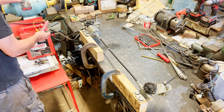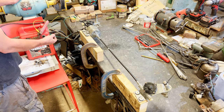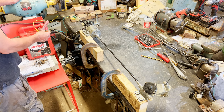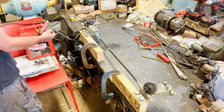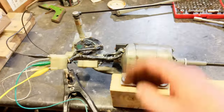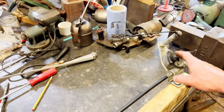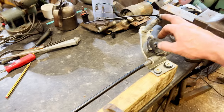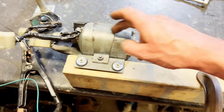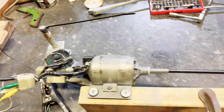There you are — it's working nicely. Feels alright. And then if you take the live away, it will park. So it's the parking switch that allows them to go back to rest. And obviously this has to be timed to that one, but we can double check that on the car. That's part of why you can undo that one — so as long as we have this in the right position to start with, we can then connect it up to this one, and this should be parked because it's all preset via the parking switch. So let's go and put it on the car and see what we've got.